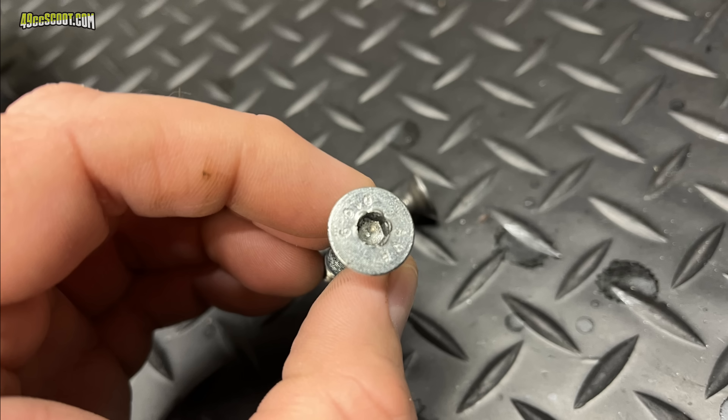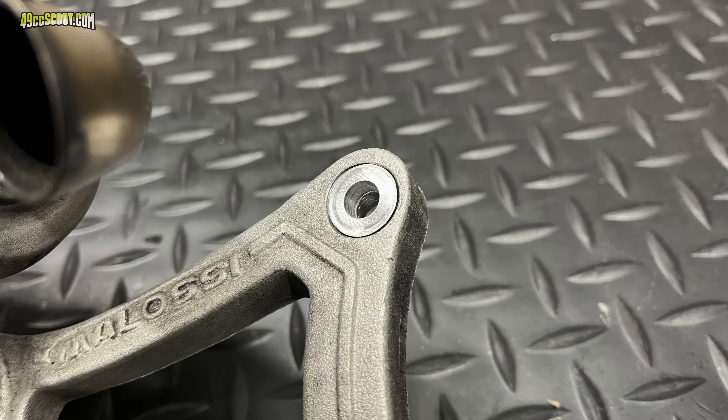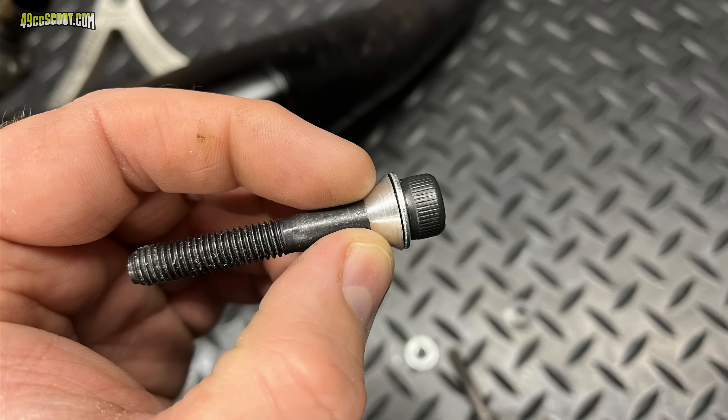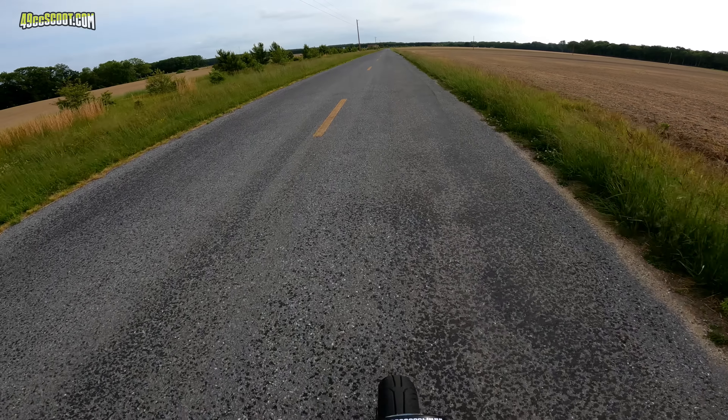I did make one small change when I reinstalled the Molossi exhaust. The countersink mount bolts included from Molossi have small hex sockets, and have never been able to withstand the recommended torque settings without stripping. I made up a couple of tapered inserts on the lathe that fit inside of the bracket, and now I can use standard Allen cap screws or just plain old hex bolts if I want to. This doesn't self-center quite so much as the tapered bolts, but if the ID of the inserts is kept close to the bolt size, it seems to work just fine. I installed a new spark plug, set the CVT back to what works with the Molossi pipe, and after a couple of quick test runs, I was ready for the car show.